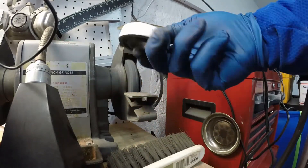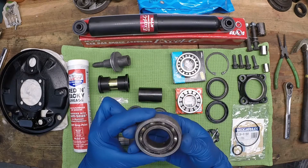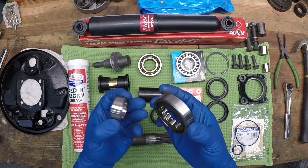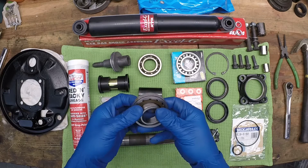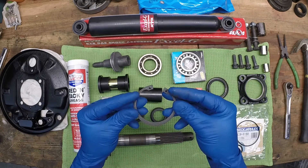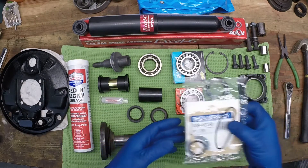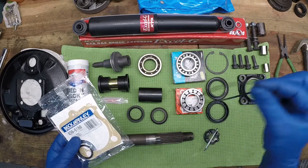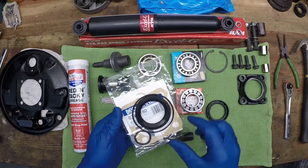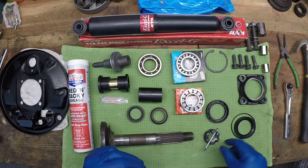If you can get an old bearing from when you took it apart and grind it down, this will help guide the new bearings into place — we'll use it as a drift. You don't have to do this but it might help. From there, you need a new inner bearing and a new outer bearing. Notice this outer one is a roller style, not a ball bearing like the inner, and it has a removable center race. You'll need a circlip to hold the inner bearing in place and two seals. For this 1971 we need two seals, so I had to buy an extra seal.